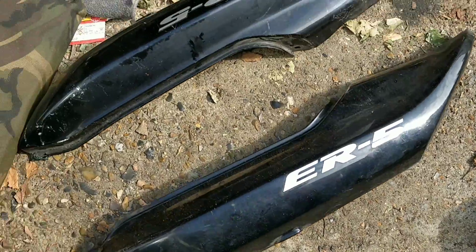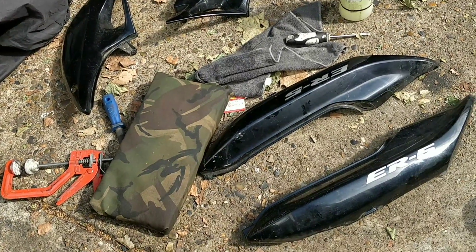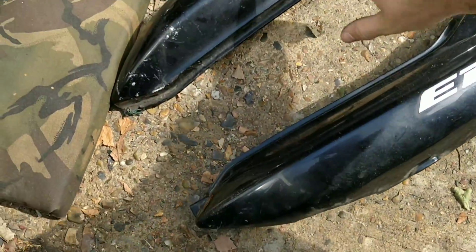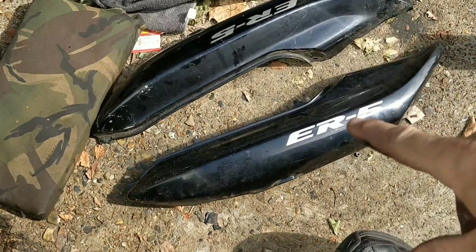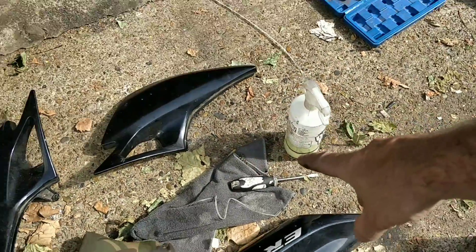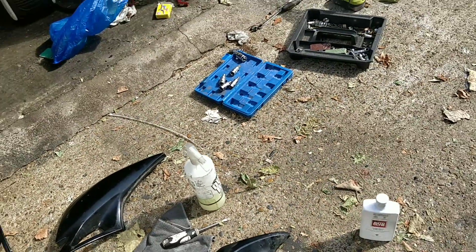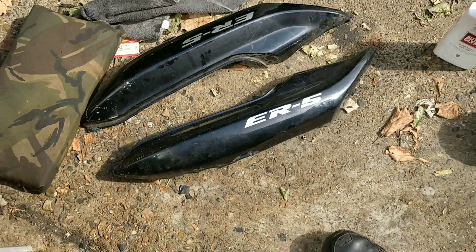If you look at the condition of these rear panels — in the same way you would prepare new paint — we can do the same for old paint. I'll use my cutting compound, my Halfords one, then this super polish, and then some wax. These panels might not be perfect but they're going to be so much better. That's what we're starting with — look closely: dirty and imperfections. Don't start throwing on compound until you've given it a good clean. Some washing up liquid is great for that with water, because you want all the residues and chemicals off. But you don't use washing up liquid on your normal good paintwork because it takes away the waxes. So I'm going to clean these up and they're going to go from what you see here to what I'm going to show you in a moment.